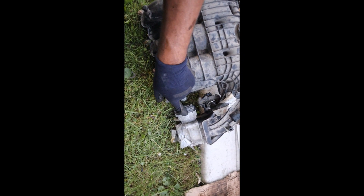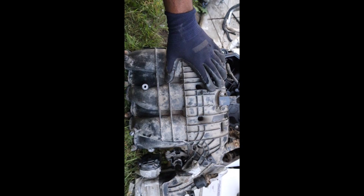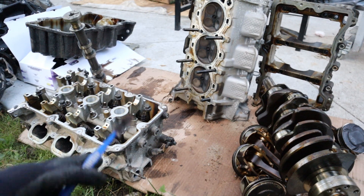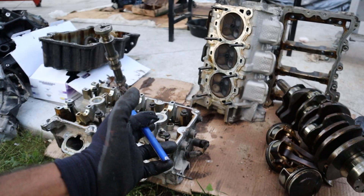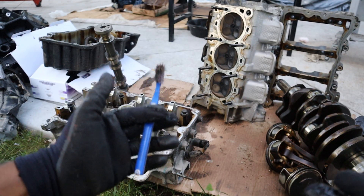The intake over here has a drive-by-wire throttle body and a manifold absolute pressure sensor at the top. There's no tumble flow control — it's a very simple basic manifold. Overall I think the Duratec V6 engine is a very simply designed engine and I actually kind of like the design. The Duratec is probably one of those forgotten engines, but everyone's going to start remembering it now because the EcoBoost engines have a much higher failure rate than these.